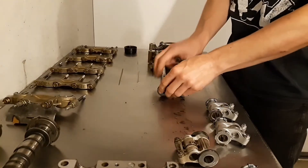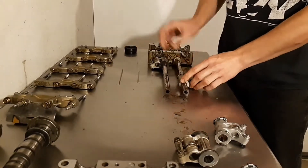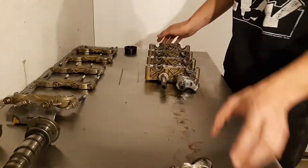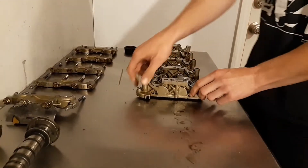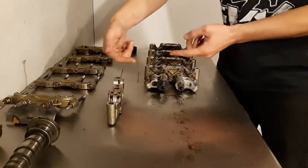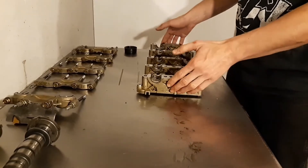When you do put everything back together, keep things in the same order they came off — like if one of these rockers came off of cylinder two, keep it with cylinder two, and so on. Rocker assembly is back together, real easy. Just try and keep these slots pointed this direction, because they've got to line up with these bolt holes. Otherwise it's not going to be too fun putting this on the cylinder head. But this is ready to be put on there.